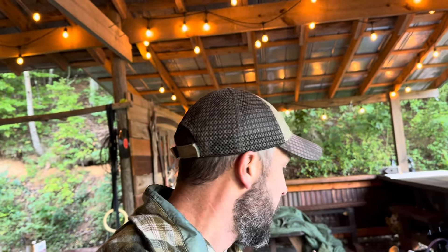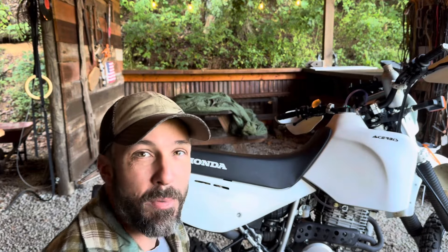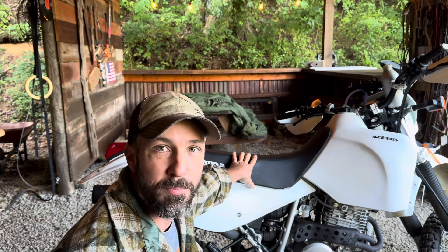Now the mixture in the carburetor is off. When the engine's cold and you blip the throttle a little bit, it misses and kind of wants to stall out because it's not getting enough fuel for the amount of air going into the engine. The mixture's off. By swapping this jet kit out, I think the engine's going to run significantly better — a little more performance — and hopefully it won't decrease my fuel economy by very much at all.